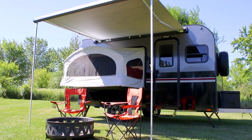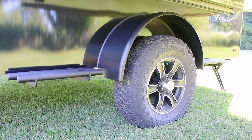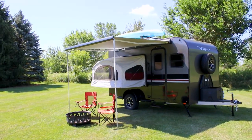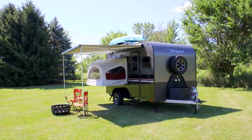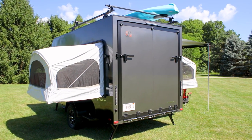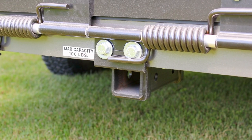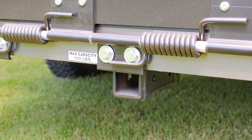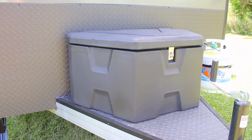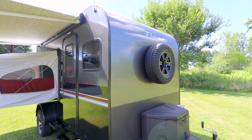On the exterior of the Discover you will find a camper ready for adventure. Discover is equipped with a 5,200 pound torsion axle. With a fully loaded dry weight of just 2,700 pounds, you'll still have a carrying capacity of 2,500 pounds, giving you plenty of room to bring along your toys. The rear ramp door is rated at 2,200 pounds for loading, and like all INTECHs, Discover comes with a 2-inch receiver rated at 100 pounds for bringing along your bikes or additional gear. Up front you will find built-in storage with our tongue box and a standard full-size spare tire mounted just above the tongue.